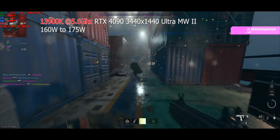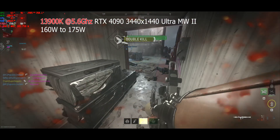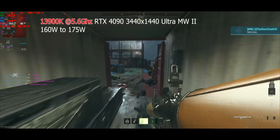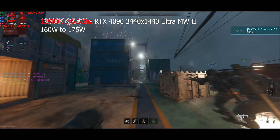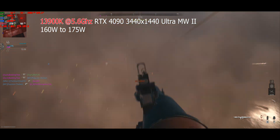So here's the deal: KS versus K, there's a big difference. I cannot run 6GHz straight out of the box with the K. My K part, I can only run at 5.6GHz super stable. If I could de-lid it, I could run more — I could actually run it at 6GHz adding some voltage — but I couldn't cool it down, and mine is just stock. No liquid metal, not de-lidded or anything like that. So at 5.6GHz is how it runs. I'll get into some gaming in a sec.